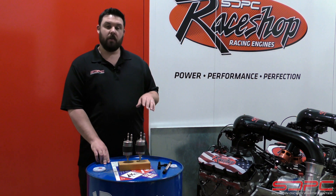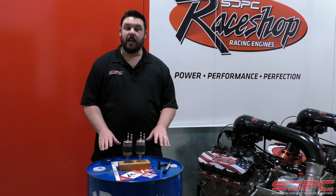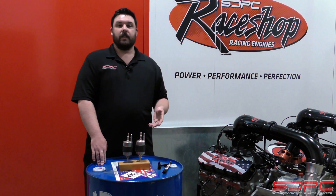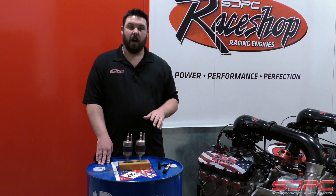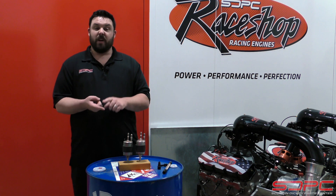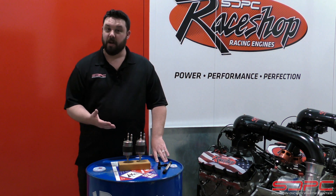We offer a lot of stuff to help you adapt a high pressure, high volume fuel system that an EFI crate engine is going to need. Your LS3, LS3 525, even an LS7 crate engine needs that high pressure, high volume fuel pump. It doesn't have to be too complicated. We offer a lot of solutions for fuel tanks that offer an in-tank fuel pump, just like OEM, from places like Rick's Tank, Holley, Aeromotive — either direct replacement fuel tanks, or of course, fuel cells for you race car guys.